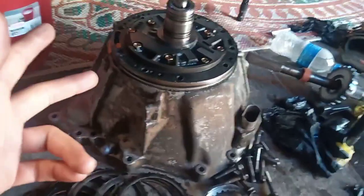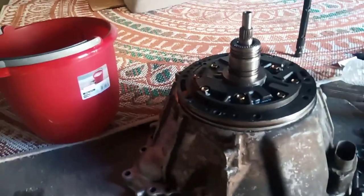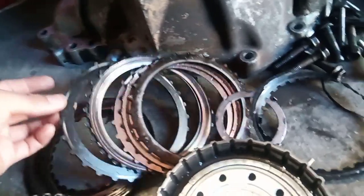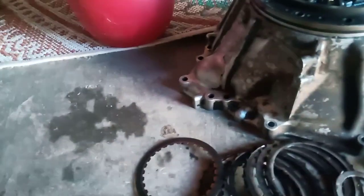One of the places I was messing up: I kept trying to put the oil pump in without an O-ring just to test fit, and it would stick out a little more than a millimeter — the manual says it should be a millimeter. As soon as I tightened the bolts, the input shaft would stop spinning and the output shaft would seize up. I adjusted clutch packs and found one that was quite bent — I thought that was for sure the issue — but after swapping it out, it still wasn't it.